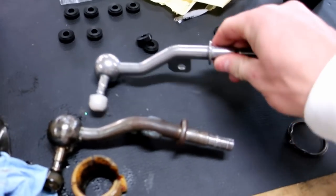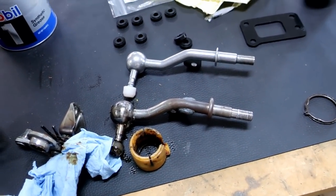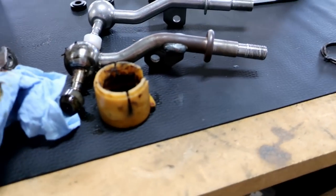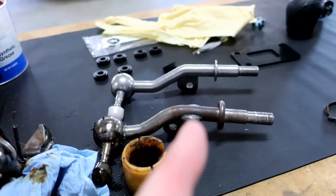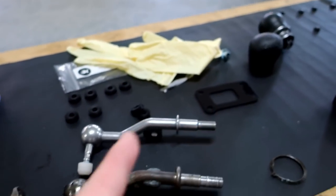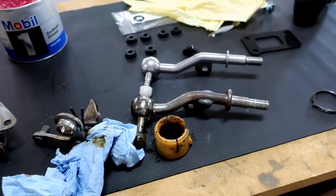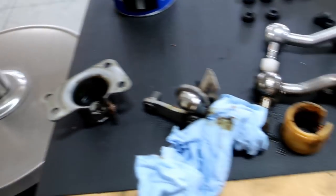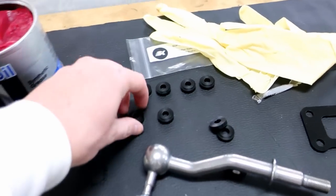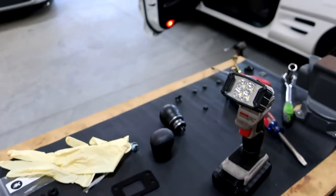Here's the side-by-side shot. Looking at it initially you're like — well, there's no difference. But what you're really doing is changing the fulcrum point, not the true length of the shifter. They're pretty much identical in length, but see the little tab — this one sits further down, this one sits further up. So when you go to shift, you're shifting quicker with this. On top of that, we have a shift plate to drop it down some too, so it's really going to change the way this fulcrum works. Now we need to clean out the rest of this gunk and install the solid shifter plate bushings, replacing all the old rubber ones. I put in new Mobil 1 grease — I can't wait to see how this feels.